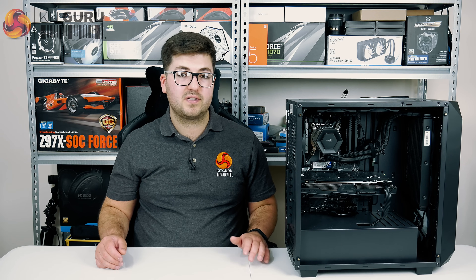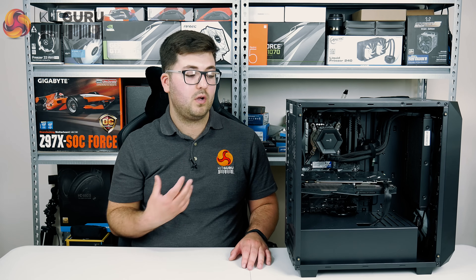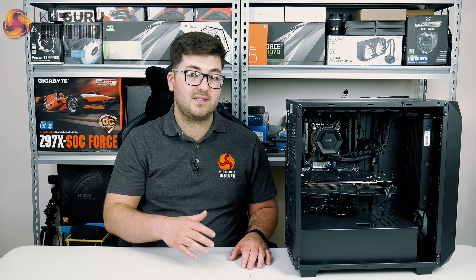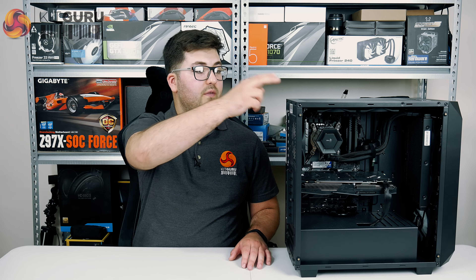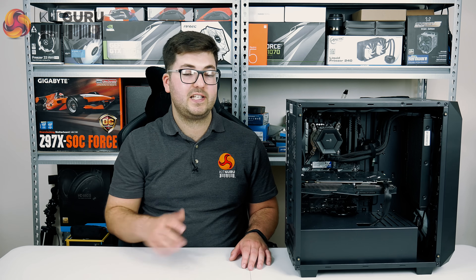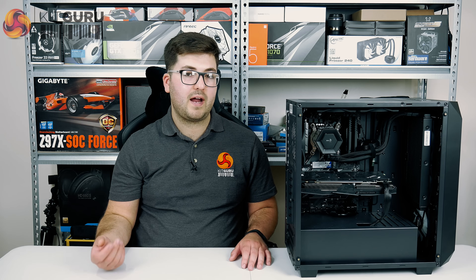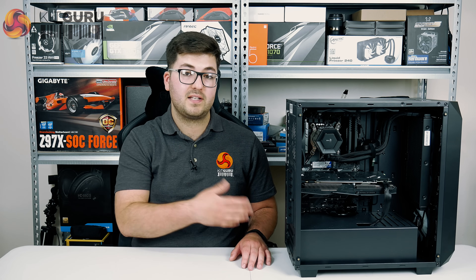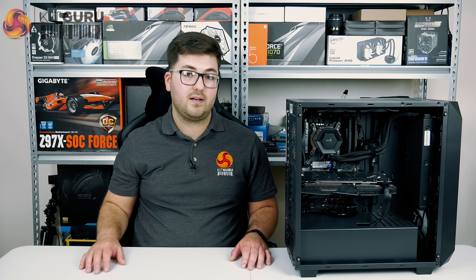Overall, wrapping up this review of the ePro7, most of it comes down to the fan configuration and the fact that it's a basic error from Mesh, which does make us lose confidence in the system as a whole. If they could promise that they'll sell it with the best fan layout — just by flipping the rear fan so you've got the front fans intaking with the roof and rear set to exhaust — then the ePro7 would be worth buying, as the total cost is actually £70 less than building the whole thing yourself, making it quite competitive. However, it's the fundamental error of the fan configuration which makes it hard to recommend as Mesh has told us they are going to sell it, so in its current form the ePro7 does need a bit of work.